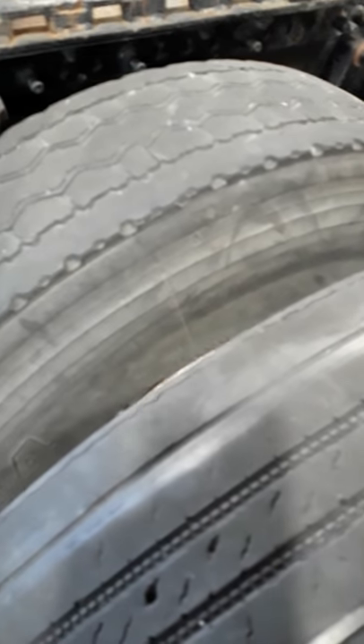On the front drive axle on the passenger side, once again we have a steer tire that's worn completely out on the inside and outside shoulders, and a recapped lug-type tire — so once again we're mismatched on tread types. The tire is actually flat, which contributes to the height difference. We also have that type of wear from the service guide — humped and worn out — which is that balance problem. It could be the shocks, it could be the tire's not balanced, it could be a bent wheel. The service guide gives you the list of steps to properly diagnose that.